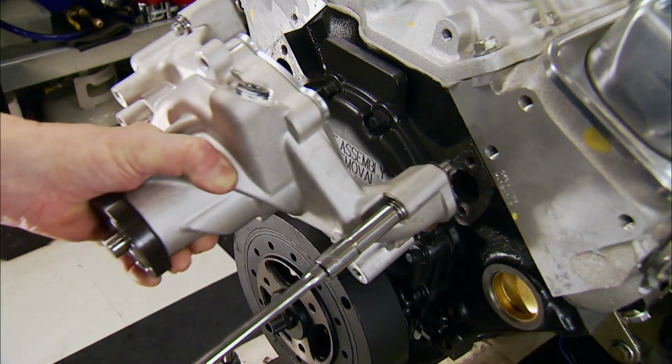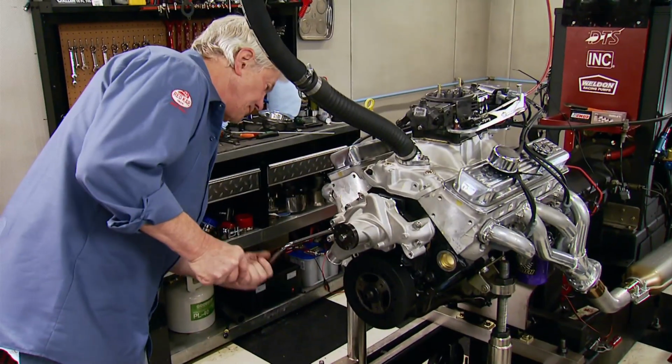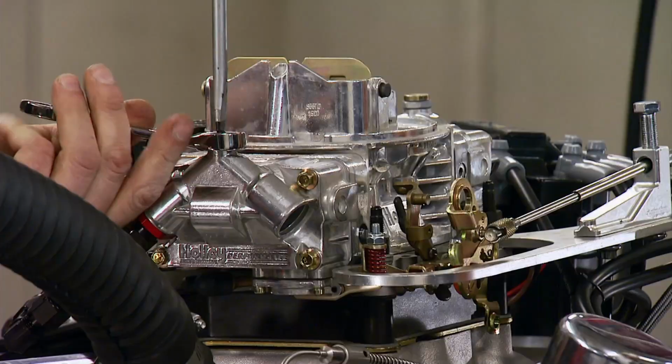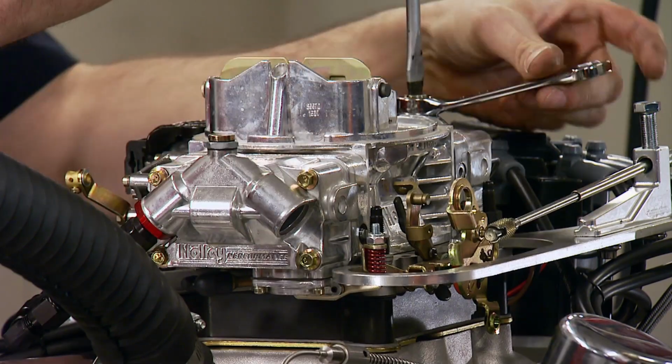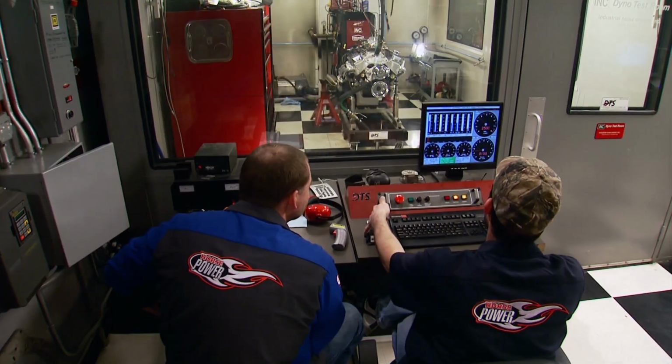We're cooling the engine with this mechanical water pump from Summit Racing. After we dyno the 3rd set of headers, we'll swap it for an electric. To feed the ZZ, we're putting this dyno-proven Holley 750 double pumper back into service.